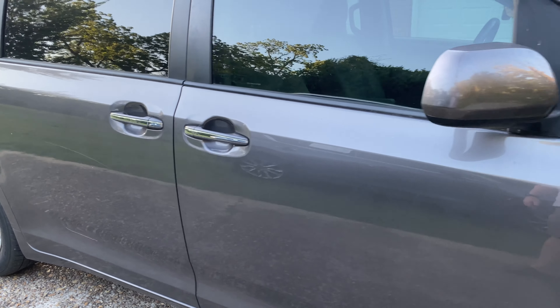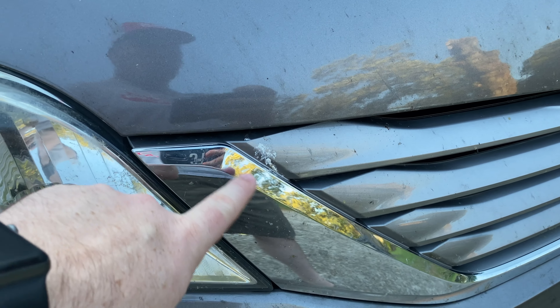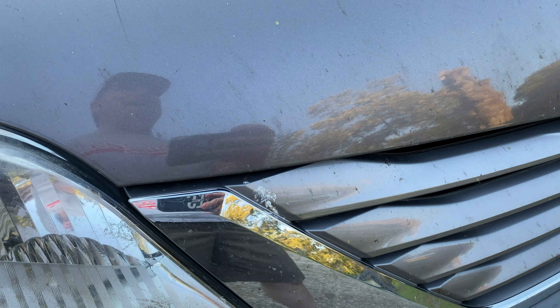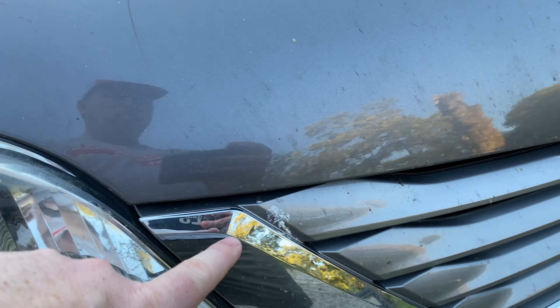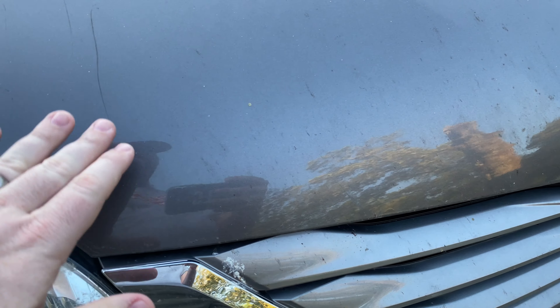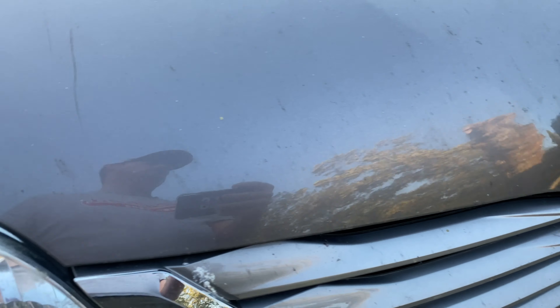The last tip is to walk around the vehicle and look at the paint. It's okay to be a little bit dirty — when I get this vehicle serviced this week they'll go ahead and wash it up. But what I'm looking for, and about the only spot I'm going to see, is this bird poop. On painted surfaces, if this sits for a long time — and this is a painted grille as well — it is acidic and can eat through your paint. So if you're going to be another couple of weeks on a quarantine or shelter at home and you have some of this activity, there are a lot of over-the-counter products, or just good old soap and water and a rag to get that right off. Products like Rain-X make some good ones — just spray it on there, let it soak in for a minute, then wipe it right off. Just check your vehicle and make sure it doesn't have extra paint damage from sitting around.